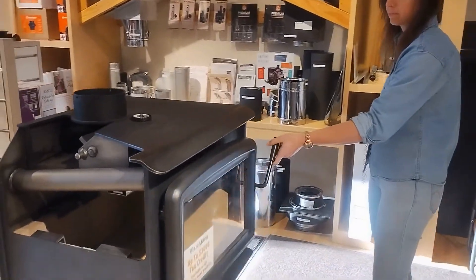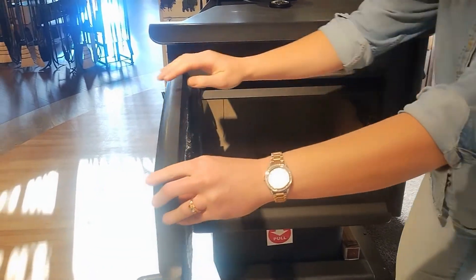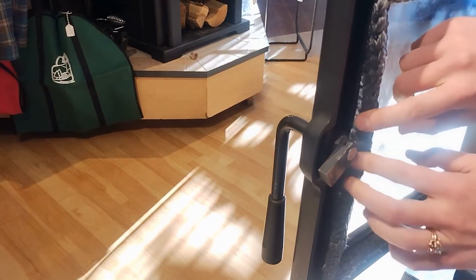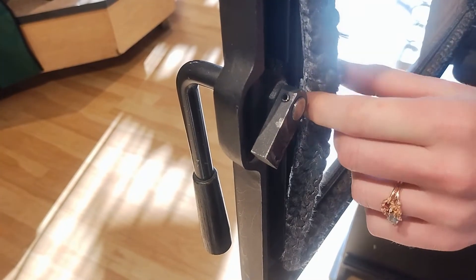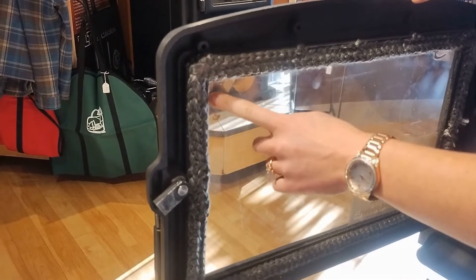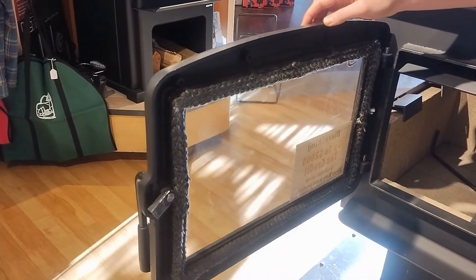We'll start with the loading door. This is called the loading door, and this is called the loading door handle. The door handle has a latch, and some door handle latches can be replaced with two screws. This one does not have two screws — we'll have to punch out that roll pin to get this door handle off. This is your door gasket, probably 7/8" diameter. Your glass gasket is behind that in a glass retainer channel. You must replace the door gasket if you are going to replace the glass gasket.